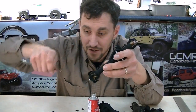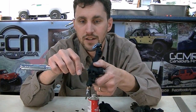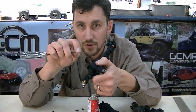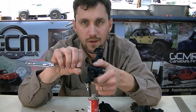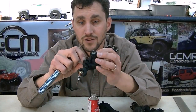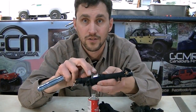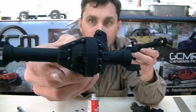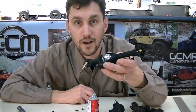You do not have to crank on these things. The same goes for the links — when you put your panhard bar up top and all the other links, the screws are already in the housing when you buy them. Just pull it out, put a little Shoe Goo on the very end of the thread where it goes into the hole, put your link in, screw it in, and just barely make contact. Let the Shoe Goo set up and it will lock your screw in there. Same with the covers — they have tiny little screws all the way around. They've got a lot of thread bite, but they're in a nylon housing, so don't crank on them.